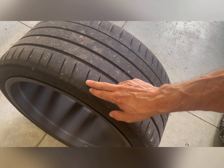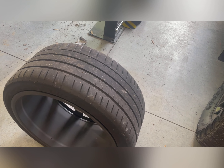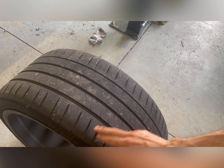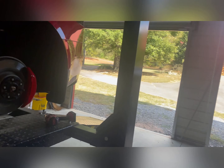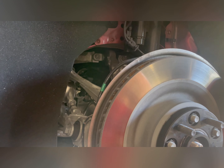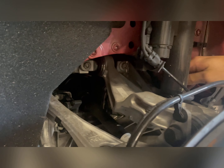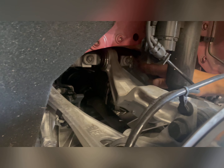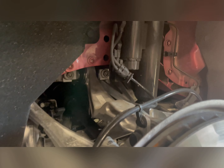You can see all this wear on the inner part of the tire — that's going to be a bad tire soon, which is unfortunate because it's only wearing on the inside and everywhere else looks like I've got tons of mileage left. That's essentially what we're fixing. We're installing the shim spacers right here — these two bolts are going to come out, we slide the spacers in, and that should correct about one degree of camber.